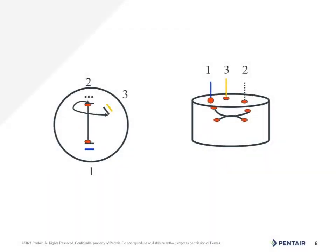This is a whiteboard drawing of the thermal overload. For this type of overload, an ohms meter should read less than 1 if reading from contact 1 to 2 and from 2 to 3. If measuring from 1 to 3, the ohm meter should read out of limit. Depending upon the manufacturer of the motor, the overload may be replaceable. It is often advised that when service is needed for any motor, an electrical motor professional should be contacted. Often an issue with the thermal overload indicates a bigger problem within the motor.